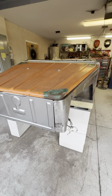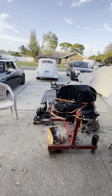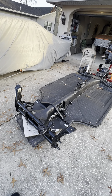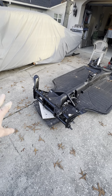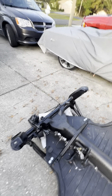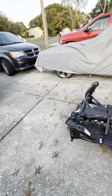We ran into some other things with the front suspension. When I got this Thing, the original beam was rotted almost in half, so I bought a Type 1 beam from a guy for $100, cleaned it up, put Zerk fittings in it. We welded the brackets from the Thing beam onto this one to make sure we had the braces just like everything is supposed to have. Got the leaf packs installed, no problem — but then the problem comes in.